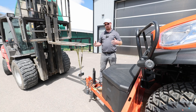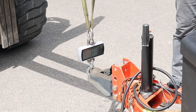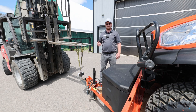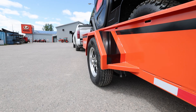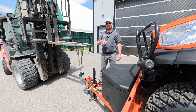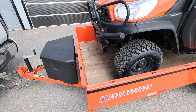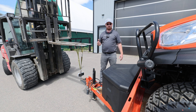We have the RTV all the way into the front of the trailer and we've got this trailer sitting level at 14 inches front to back. We're now sitting at 635 pounds of tongue weight — we've gone up 30 pounds by leveling this trailer out. That 30 pounds went to the back when you were riding too high, meaning it's on the back axle, at the back of the trailer. That's what creates fishtailing — when you're not proportioned correctly. The next step is moving this RTV to the center of the trailer, where you should be positioned when strapping down, and seeing what tongue weight that gets us.